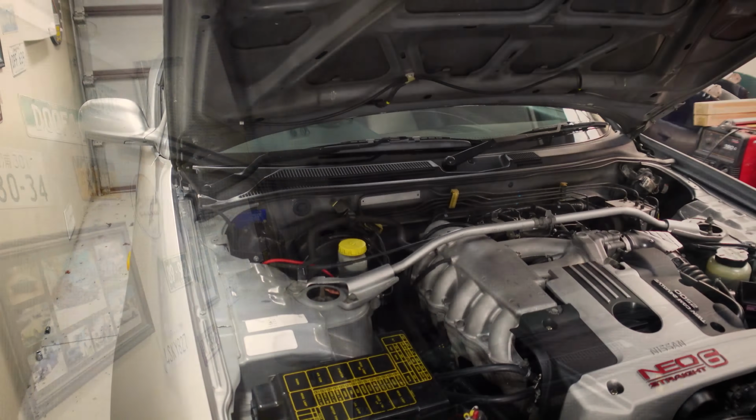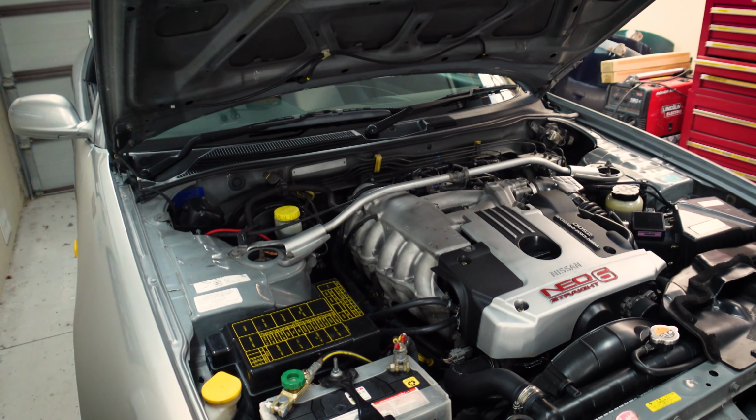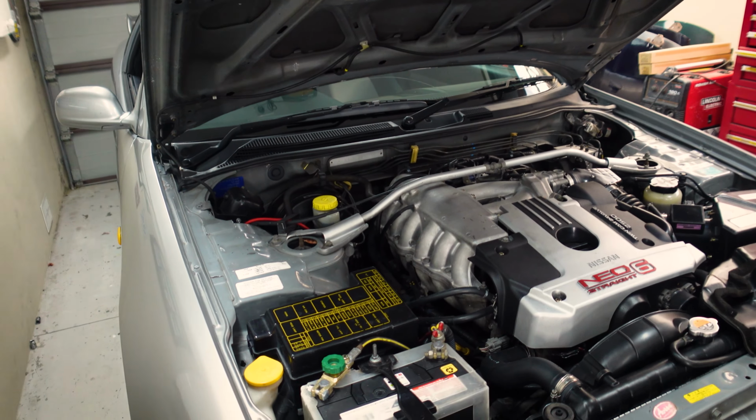But yeah, overall, this gearbox is rated as 8.3 litres of capacity. So, you know, if you're only dropping the sump and getting 2 litres out of it, you're basically just watering down whatever dodgy fluid is in there when you pour your new stuff in. So yeah, we've got a bunch of fluid for this. We've got new filters and a new gasket for the sump. But the next step is going to be, let's get under the car and see what we're working with.